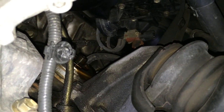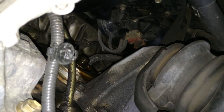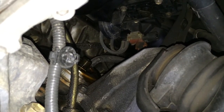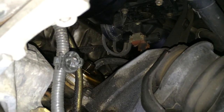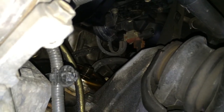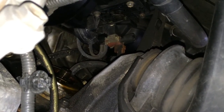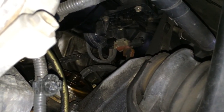What I've heard is to remove the two vacuum lines and block them off. Leave the valve connected — just literally undo the two vacuum lines and block off all the ends. I believe it's on the short intake tract, which is apparently what you want. That little kick you feel at about 4,500 RPM is the ACIS — I forget, either opening or closing — but it's switching over to the short air intake from the long runner intake.